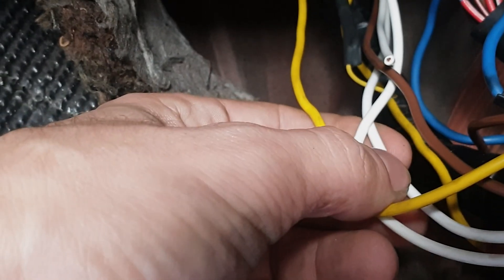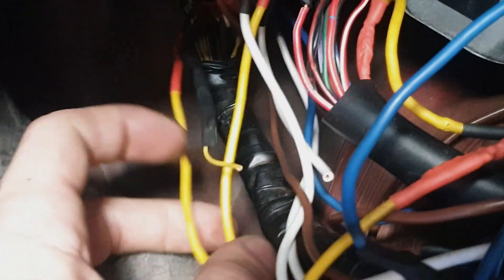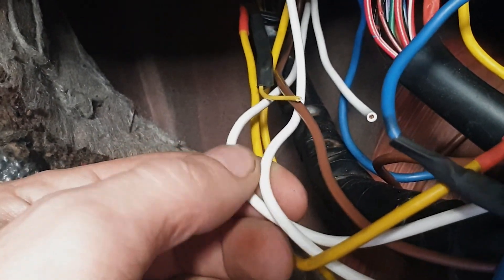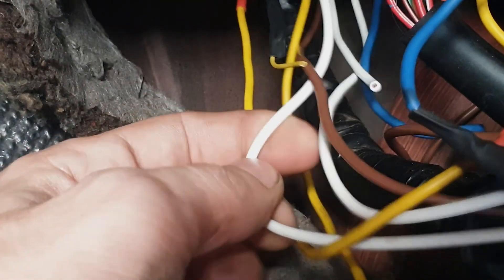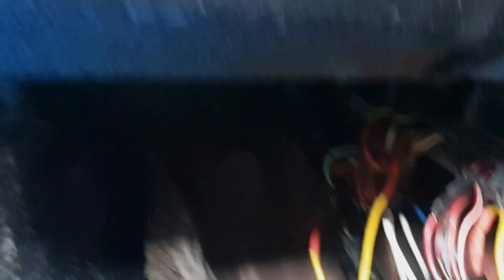You've got 12 volt, that one there is my MAP — actually sorry, I've got that the wrong way around. This here is my MAP in, coming from the MAP sensor, and then this one here is the MAP out coming from the DET3 to the ECU — so that's the one playing with the signal. This one here is my coolant. I'm not quite sure what the other one I've got referenced in the computer — I'll have to check it. And then that one there — there you go — that one's the timing.